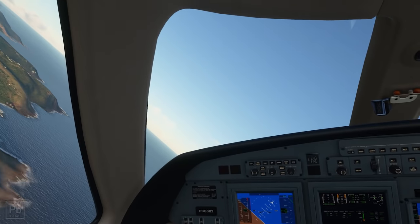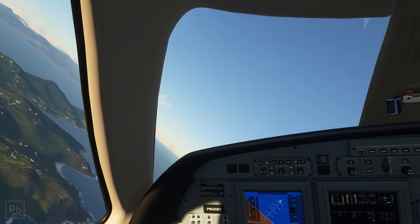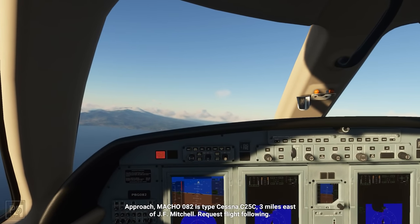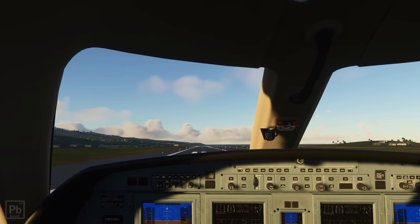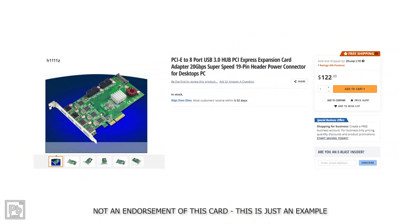To use the X56, you're pretty much going to have to install a PCIe USB hub, so that the USB ports powering the X56 draw their own power from the power supply rather than share power with other motherboard components. You're going to need every tiny increment of power USB is rated to deliver — anything less, and these become worse than impossible to use. Most of you are savvy enough to put a graphics card in, so what's the problem grabbing a PCIe USB hub? Well, principally cost. Yes, you can buy them for around $35 from Amazon, and these will work for a month or two. Even then, you can only plug in the X56, so ignore all those other slots on the card. The design quality of these cards is garbage and you risk damaging your entire motherboard. One of these cards generated multiple BSODs. These cheap ones are always single channel, so you risk compounding the multiple commands issue as the PC gets a signal from one device and thinks it might be the other — hard over on the throttle Y axis might be full power to the engines, but for the stick it's dive the pitch. So you'll need to really spend some money and grab one of the $100 to $200 versions.